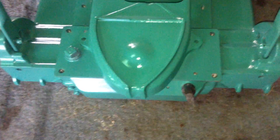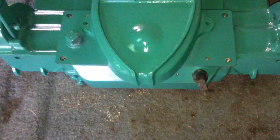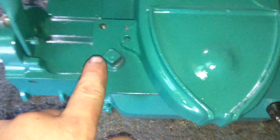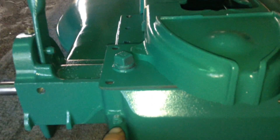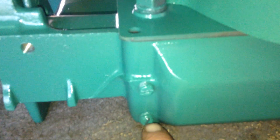On the Ward's master quality rotary mower, for the rear transmission assembly, this is your fill plug for your gear oil. You remove a little flathead screw, and when you're filling it, when the oil starts coming out, that's how you know it's full.